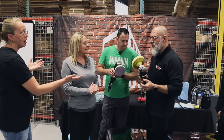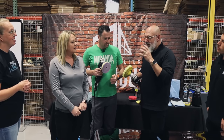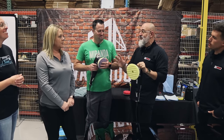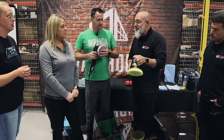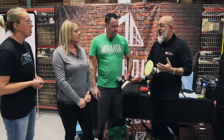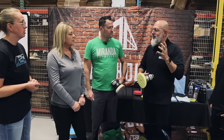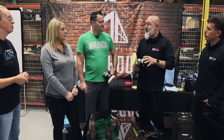Most people are scared of the rotary. That is a great marketing myth brought on by many companies that came out with a DA. People have this fear that it's going to burn the paint off the car. The way we used to use a rotary back in the 70s and 80s — we called it a high-speed machine — was full speed on an angle with pressure. Now when we wanted to finish, we'd turn the speed down and keep the pad flat. Nobody ever saw that part; all they saw was the aggressive technique.